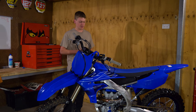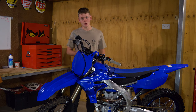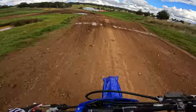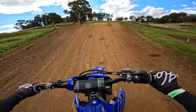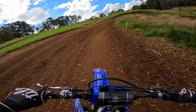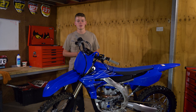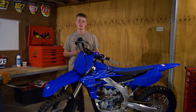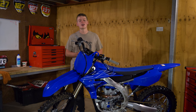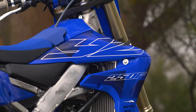With brand new bikes, the oil, clutch plates, and gears are all new. You're going to want to get all that oil moving and dispersed over all the parts. You may notice a few things feel a little funky at first, but that's just a brand new bike — everything's got to bed in. If anything feels too funky, go see a local mechanic and they'll sort it out. Just ride at a nice slow speed, maybe lug a little in third or fourth gear. All you're doing is getting oil over all the parts and getting the gears used, since brand new gears have hard facings and manufacturing marks. Same idea as with your clutch and brakes — just get it moving and warm. It'll create a more reliable and safer ride.